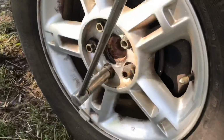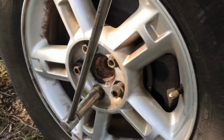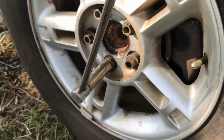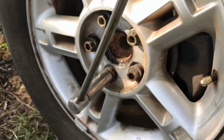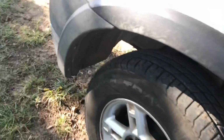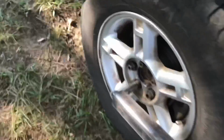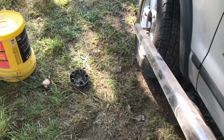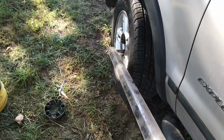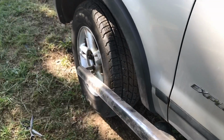All the lugs, get these torqued down there at 140 right now. I'll go get the big 10-foot bar and torque them down before that Loctite dries on there. Then put the hubcap and stuff back on. Got the big bar on there now, and this is just a ratchet, but it is welded solid on the inside, so it's like a breaker bar, basically. And that's about as much as I'm gonna get them on there. So I'll round them off the rest of the way, then put the hubcaps and stuff back on there.